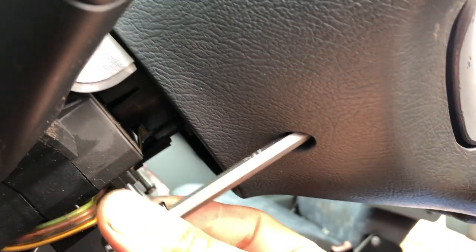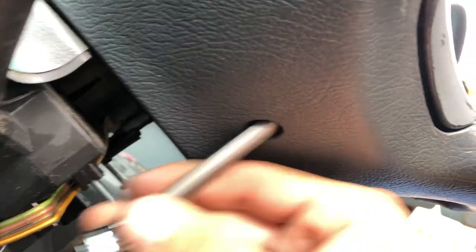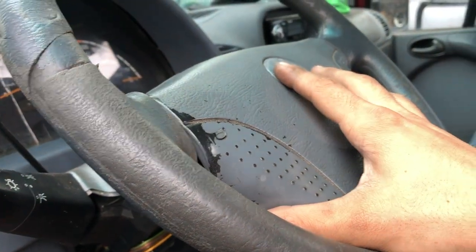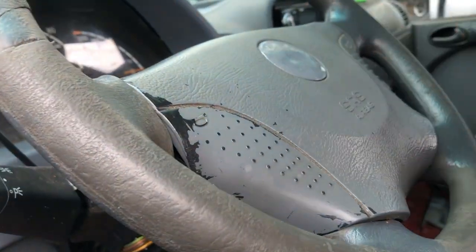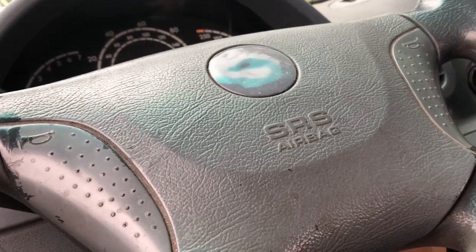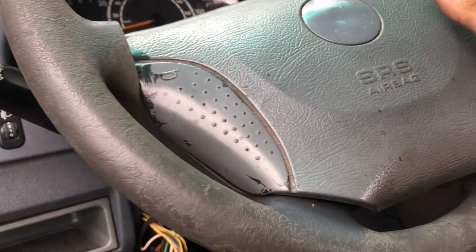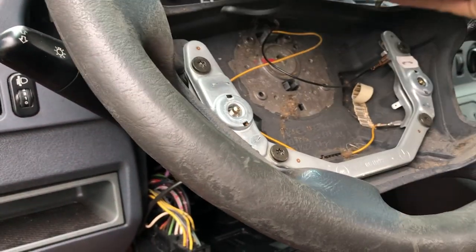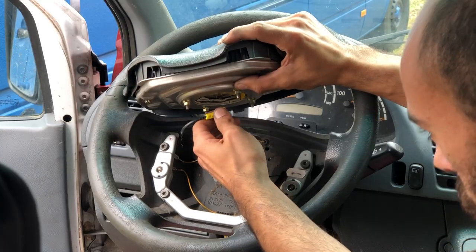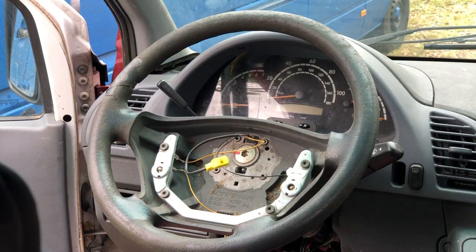Making sure the battery is disconnected — there's one bolt on this side. The bolts that hold the airbag cover in are captive bolts; they're not very tight and they don't need a lot of torque once they're back in. Since they're captive you don't have to worry about them falling out. Now you should be able to carefully lift the airbag out — this connector just pulls right off pretty easily, and then it is safe to set it aside.